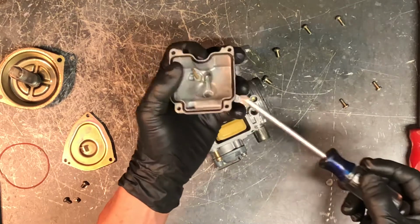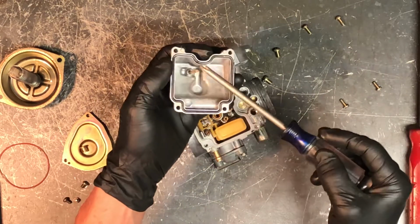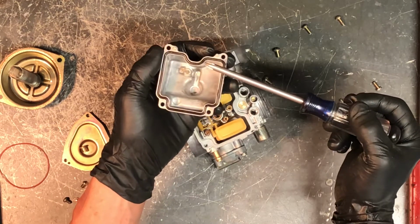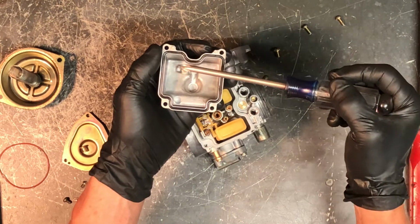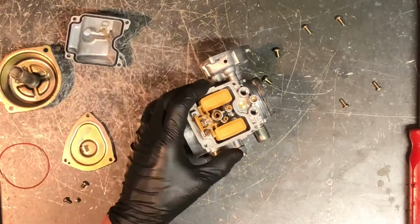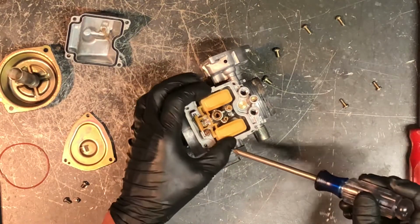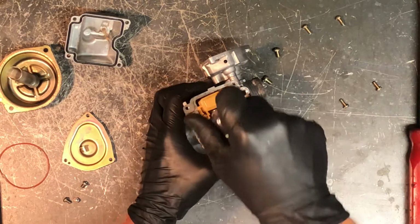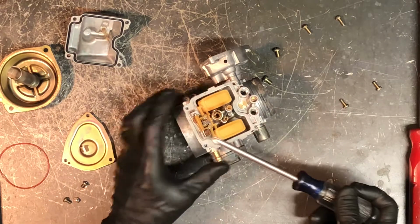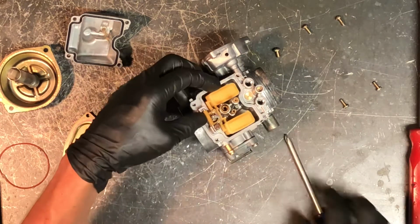Just the same if you're traveling. That's kind of a safety deal there, so that fuel does not go down into the motor. It drains out there. So now we'll pull this float off here, and that takes a Phillips screw to remove that. You just have to loosen that Phillips screw there, in order to get this far enough off.